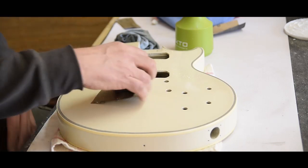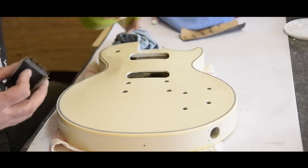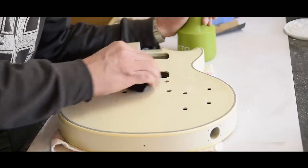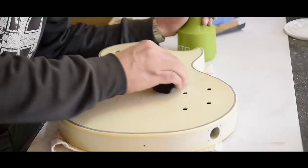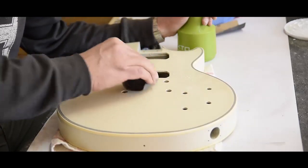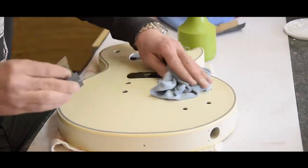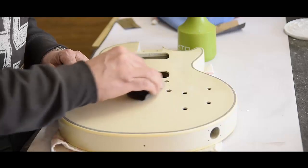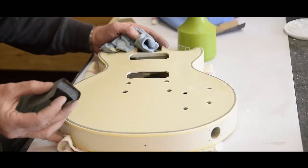Right, just exactly the same way I've painted the white, with three light coats and two heavy coats. I'm sanding back the clear coat now with a progressive 1000 and then 1500, after which I will buff. Once again, I have a light in front of me reflecting off the surface, and I can see where the little divots are, and I'm looking for a completely flat and featureless surface. It must be completely flat.